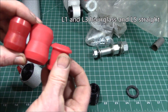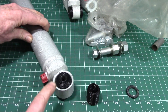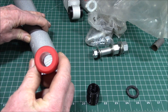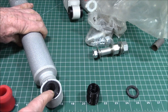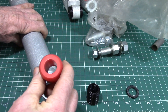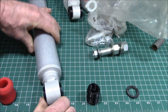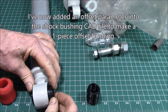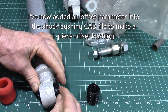Those two are their most common bushing types on this end. The Mazda needs a 12 millimeter bolt — not 19 or three-quarter inch — and on this end they need a 20 millimeter bore, which means you would have to bore that out, which is really time consuming. I've been there and done that. The other problem is that the Mazda shock bushing is asymmetrical, so what we did with the 3D printer was print a ring or spacer here.